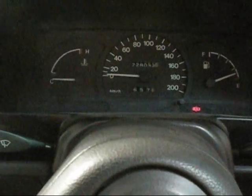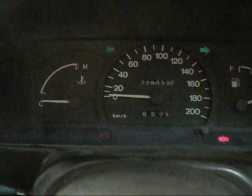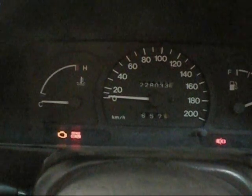Now I'm back to this Daewoo piece of shit. I put that new module in, it ran fine, and then about 5 minutes after I did the video, it started hunting. So later on that night I started again, it was fine, I revved the crap out of it and it started hunting. I just started it then, it ran fine, I gave it a small rev and it started hunting. There we go, computer stuff. Now I can't rev it up, it just backfires.